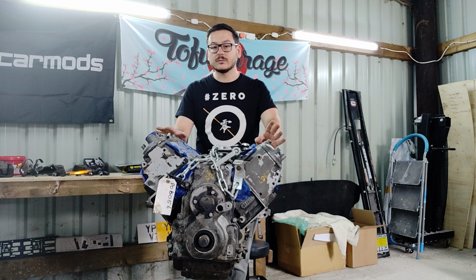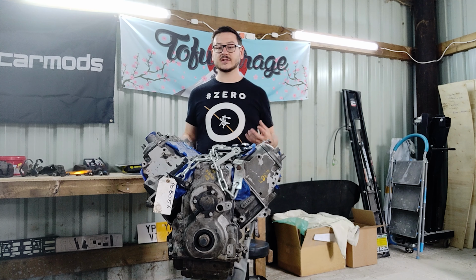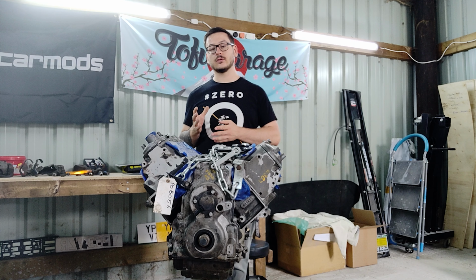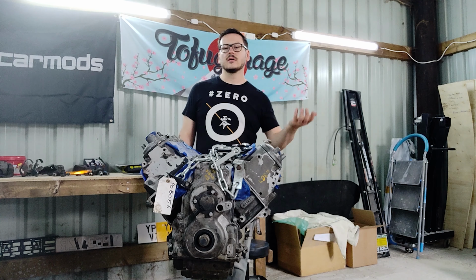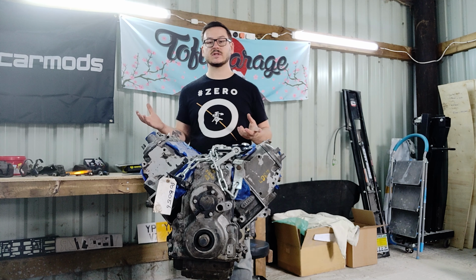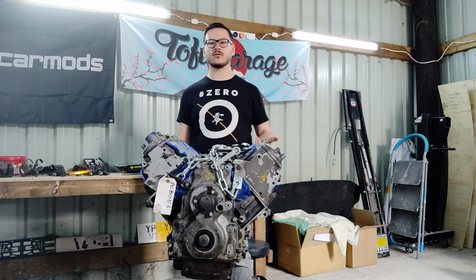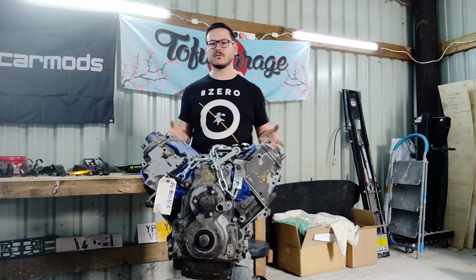When it comes to gearboxes themselves, there's a few options. You could go with the bolt-on T56 or TR6060, although they are very expensive gearboxes in the UK. So I'm likely to go for a cheaper option such as the Nissan CD009, which people will often know from the 350Z. Incredibly strong gearboxes, relatively cheap compared to the T56, and it's been done plenty of times in the 86 platform, and with a little bit of finessing here and there, some clearancing, it can fit nice and easily.